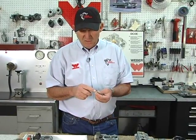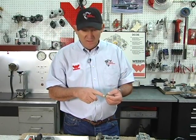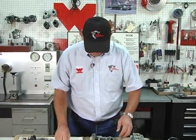So you can get one that gets real rich on the high end and the ball's stuck, and it just starts a siphon of raw fuel. It's raw fuel. It's just there to give it a squirt. It's like a burst of fuel to keep the engine running smooth while the next circuit receives its signals from the engine and starts functioning properly.